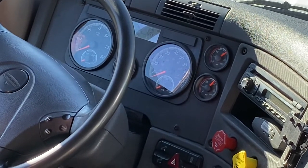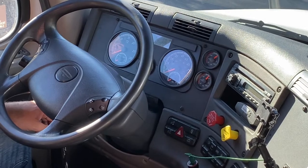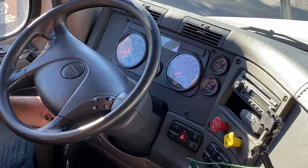I will start a one-minute timer. We cannot lose more than two pounds of air for a straight truck or three pounds of air for a combination vehicle, which this is.